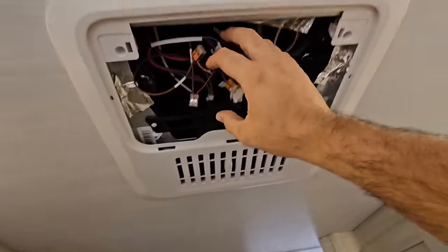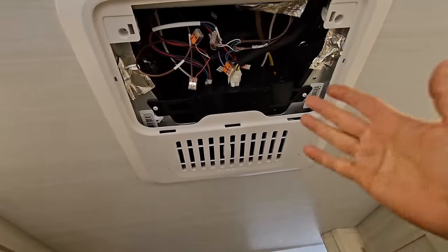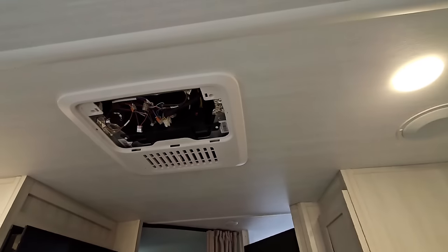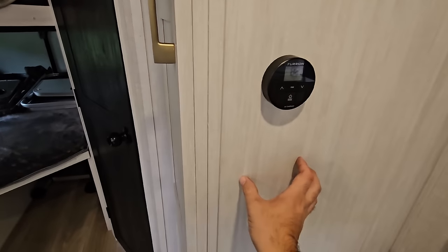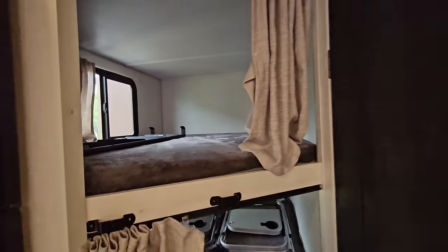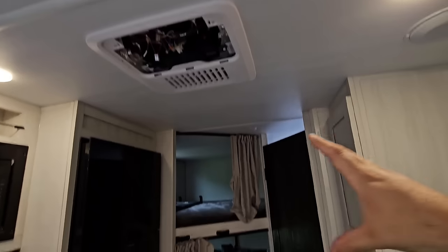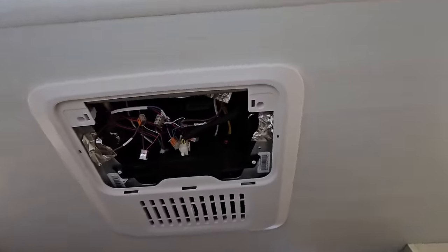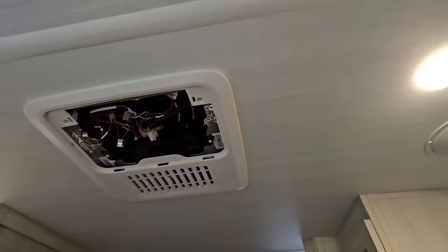We won't have any wires going from here to the thermostat because it's all wireless. There's a remote that I control all of the functions from, and it also acts as a thermostat with follow me, which basically means if I take the thermostat from here, if I choose to put it on the wall here, and I put it up here on the bunk, this is where it's reading air temperature, and it will try to make sure that the inside of the RV gets to the temperature that the thermostat is set for. Super cool. But the process to get started here is to remove the screws from here, and then we'll get to the wiring aspect.